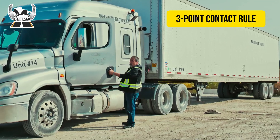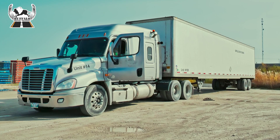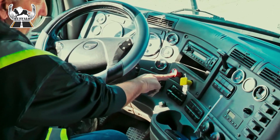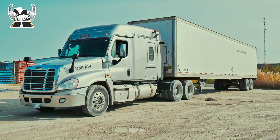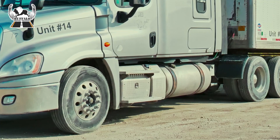Always when you're getting in and out of the truck, it's three points of contact. Once again I'm inside, I'm putting on my seat belt, starting the truck. Now right now both brakes are applied — the trailer brake and the tractor brake. I'm going to push in my yellow valve which is my tractor spring brakes, and check against the trailer spring brake. I do a slight tug — brakes are holding.